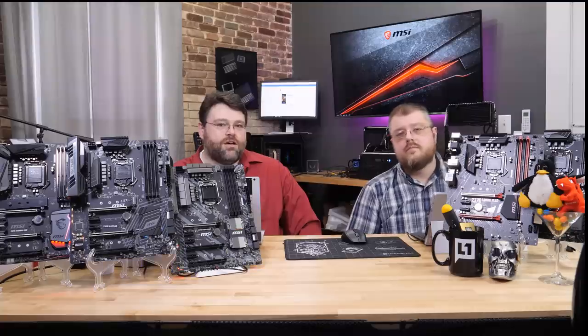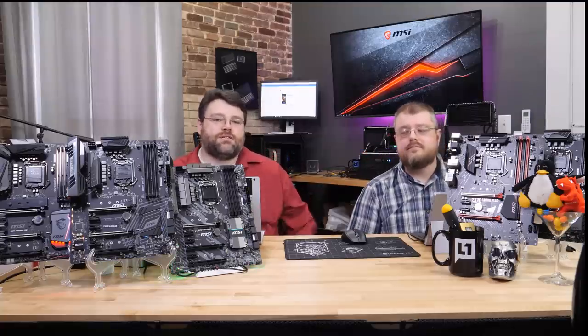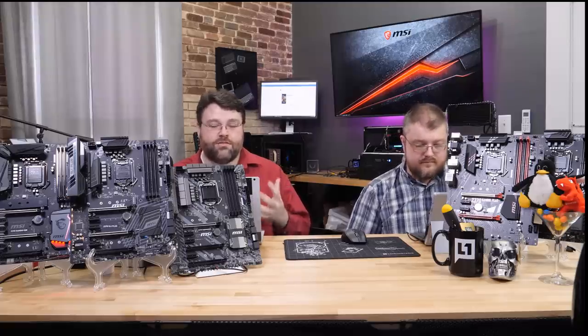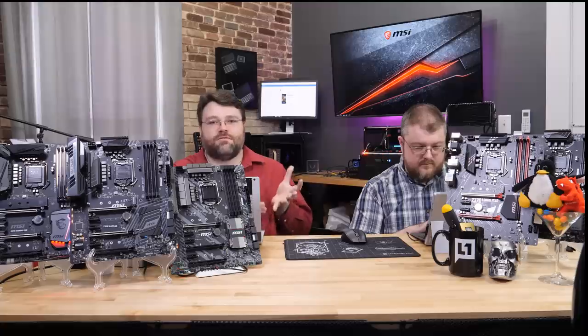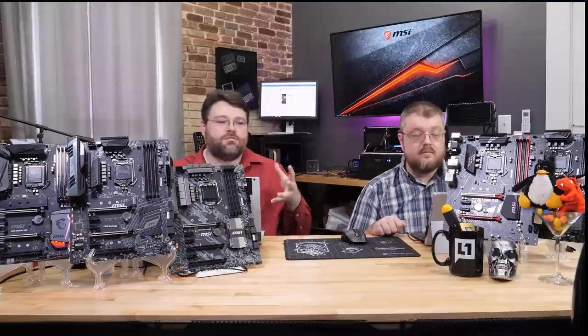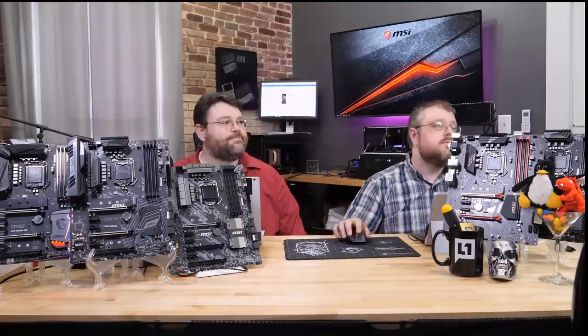But if you're running M.2 RAID, it's still basically the same situation for PCI Express on that side of things. It's just that Intel provides more PCI Express connectivity off of the chipset for peripherals, but there's not more bandwidth between the chipset and the CPU. So that's only for the super nerds out there.